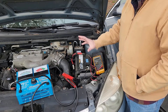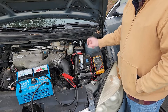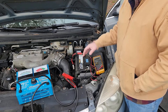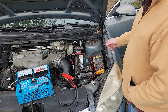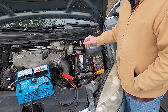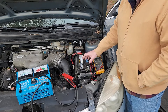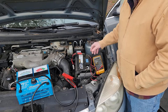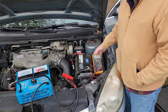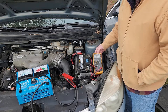The first thing I did was start the car up the other day — the battery indicator light came on. I measured the battery voltage while the engine was running and it was about 13.5 volts; it should be around 14 volts. I started it up today and it's reading 15.15 volts and the charge indicator light isn't on. I ran it for about five minutes to charge it back up. Right now I've got the multimeter across the two leads and it's been dropping since I shut the car off.